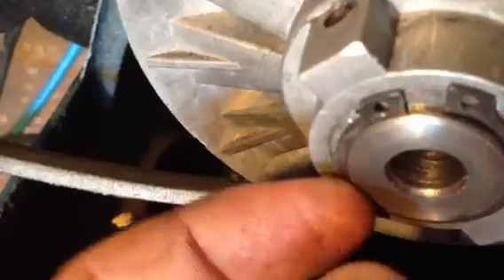It has to slip on far enough so that the groove where the circlip is inserted sticks out a little bit, so you can stick the circlip back on. Now, you're going to find it difficult, if not impossible, to push the speed control back unless it's moving. So turn it on and move it back to the lowest position — about there. You could take it one step lower, but you risk popping off the circlip because that pushes it out a little bit too far.